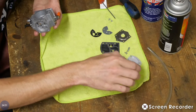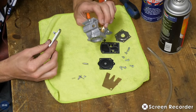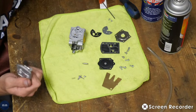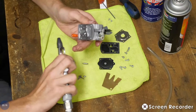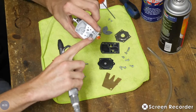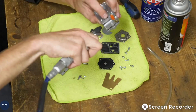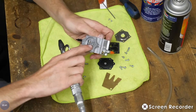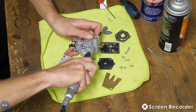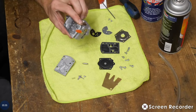If you're ever told to clean your carburetor, this is the part you want to break it down to. Leave all of this stuff out and soak this piece and this whole carburetor — you can soak it in gas overnight, that's okay. Now it's been soaking in gas all night. All we're going to do now is go through it with an air compressor and squirt out the carburetor itself. Make sure you keep your finger over this little screen here while squirting it out. And if you want to clean out that screen, all you do is hold your finger lightly over the top, and on the other side where you took the little needle out, you just squirt into that hole. The screen is now clean and you don't have to remove it — if you do remove it, it is just hard to get back in.